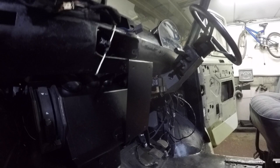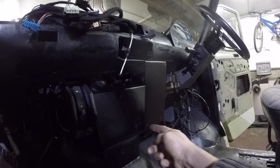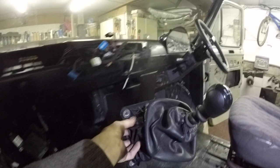I'll put just two bolts into the dashboard, so if I need to take the heater box out, I can just undo them two nuts and bolts. Welded some nuts behind here, so I've then just painted it with a bit of satin black, and then this will just bolt on now - the mechanism. I'll get that bolted on there and then start sorting out the cabling.